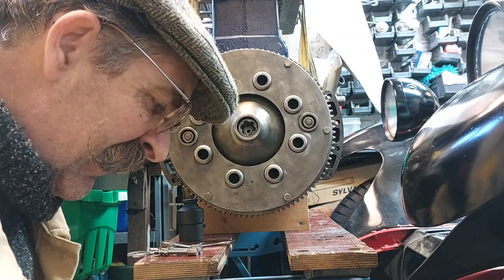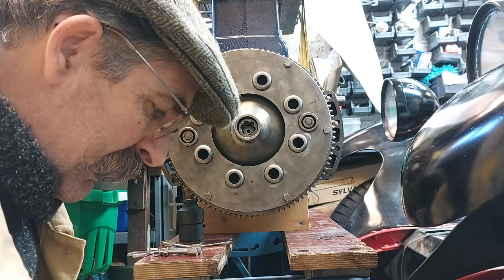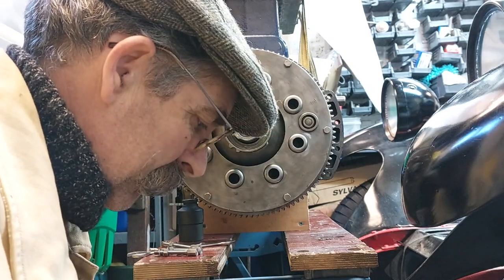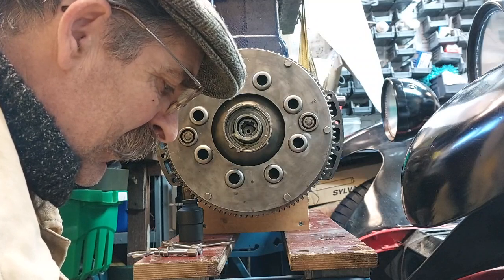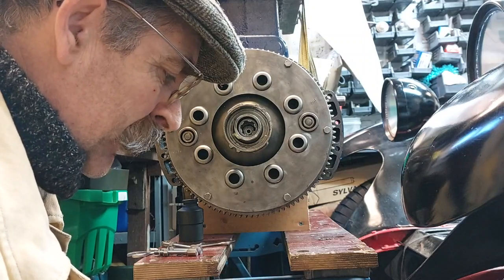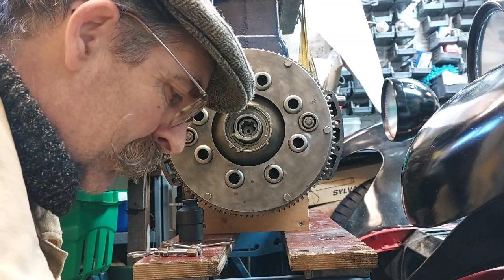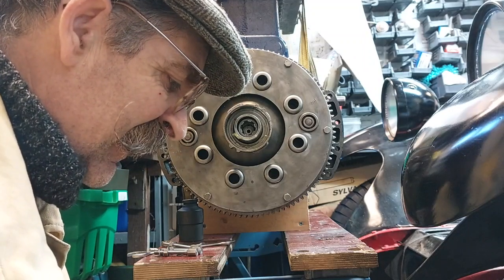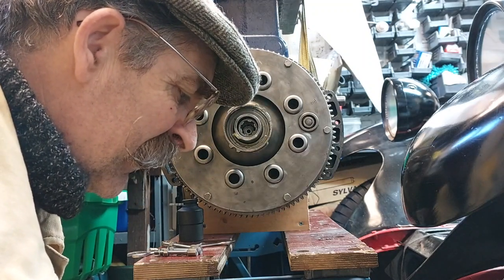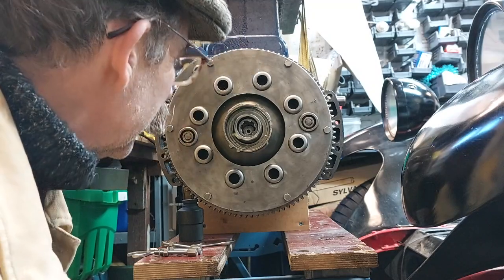And then just the thrust bearing to go on. That'll give it a bit of a grease in. And then generally what you do is take the floorboards up, unbolt the cover on the bell housing, and occasionally dribble some oil in there, but not too much oil, otherwise it goes on the clutch. And yeah, nothing like a bit of simple maintenance. So I can see why these go dry. People don't want to keep pulling the floorboards up.